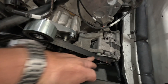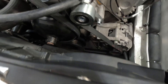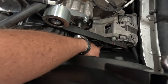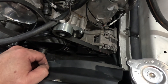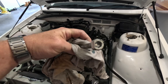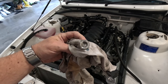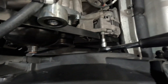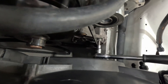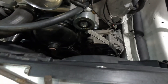I think we might be onto something, but I need to deal with this bolt — yeah, that's going to touch. Actually, I'm going to have a larger diameter crank pulley now too, so that bolt won't be a worry. We could always put that bolt here. We're getting somewhere, just getting there very slowly. I ground the edge of that down, threw it back in — you can just see that clearance there on that bolt.